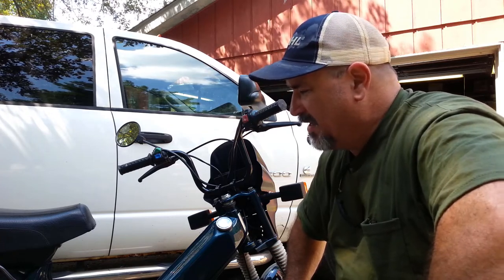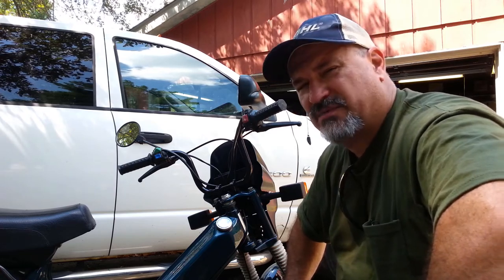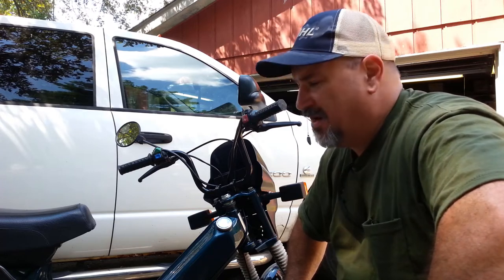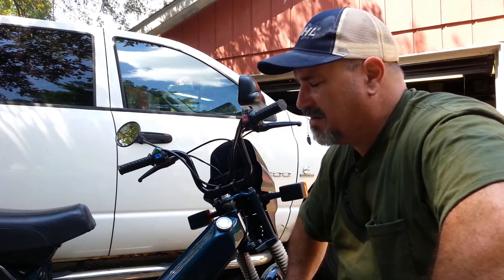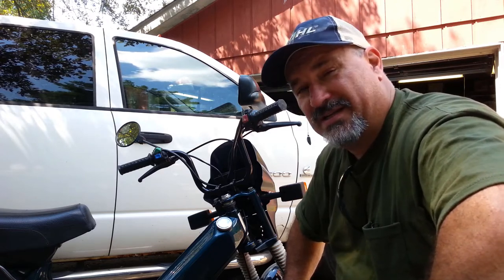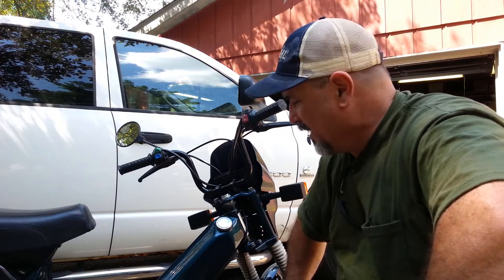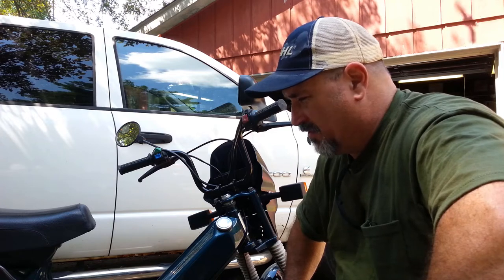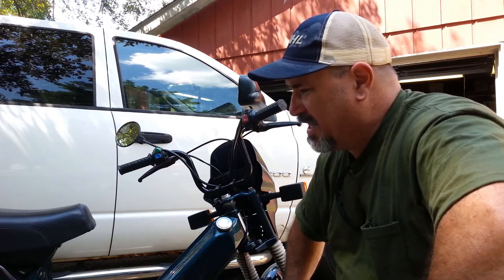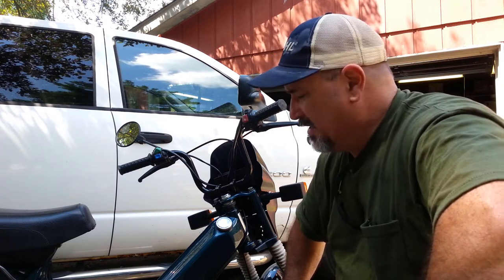As it is now, if I hold the throttle, it stays in first gear to about 20, and it's at maximum RPM. And it doesn't really ever get into second gear. When I release it and let it get into second gear, if I give it full throttle between 20 and 23, it slips. At like 23 and up, once it gets a grip, it won't slip anymore. So I don't want it slipping. I want it shifting as firm as possible. So I'm going to go back to the factory fluid setup and then change it a little bit at a time from there.